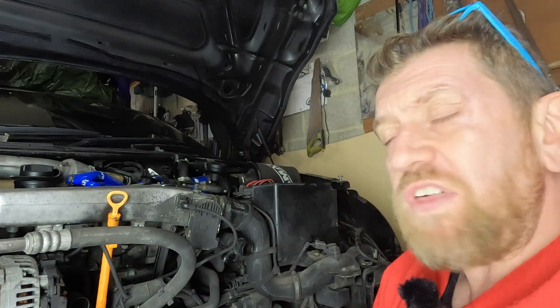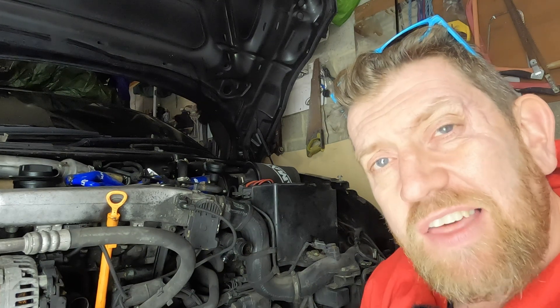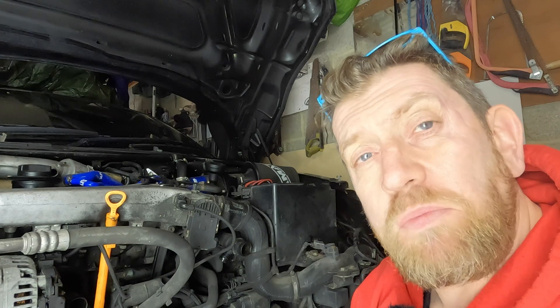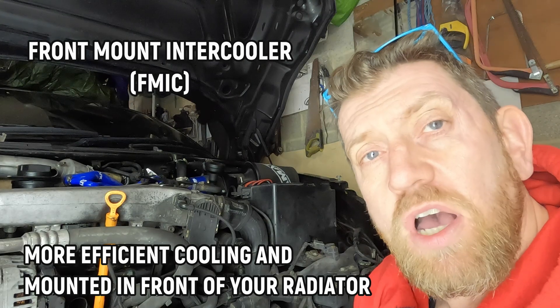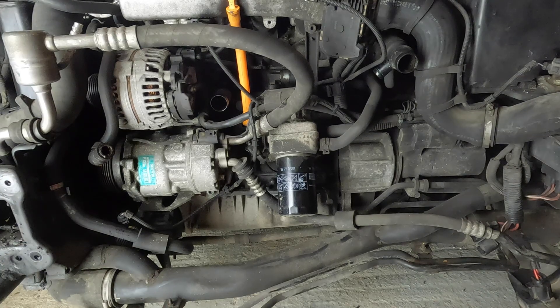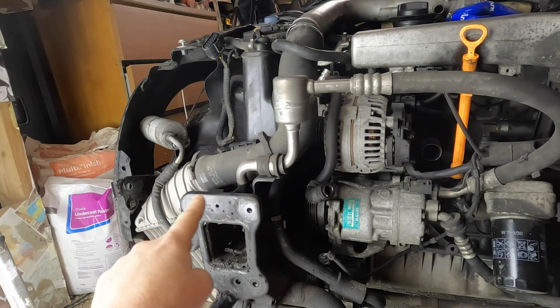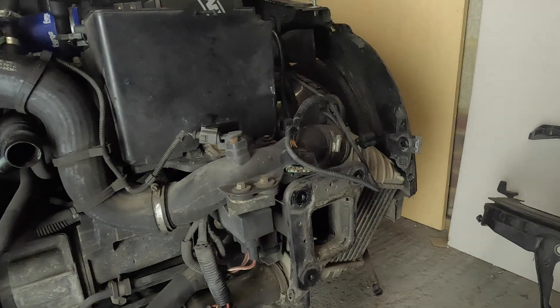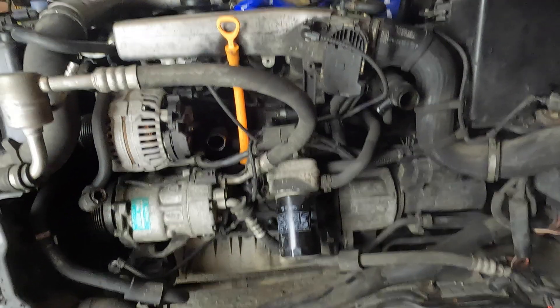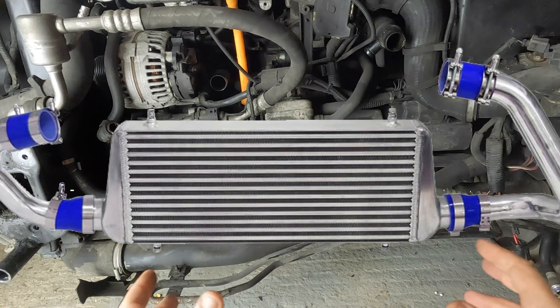The air again flows through this radiator and comes out at the top of the intercooler, along this plastic pipe, into a rubber S-bend, and then it enters the inlet manifold just here. So your air from the turbo is going through two radiators, or intercoolers, either side of the car for maximum cooling efficiency before it enters the inlet manifold. However, don't forget that a larger cone filter breathing in warm air is going to need a lot more cooling to get the air down to temperature.